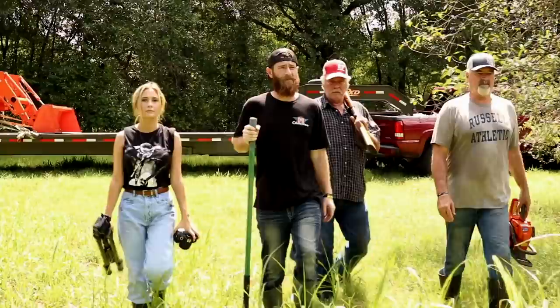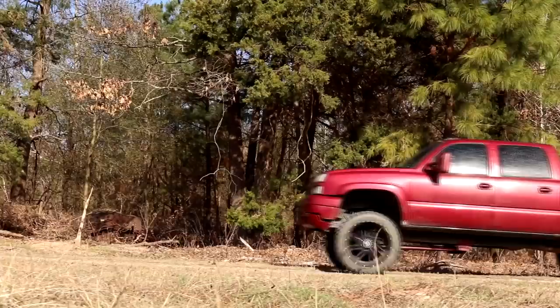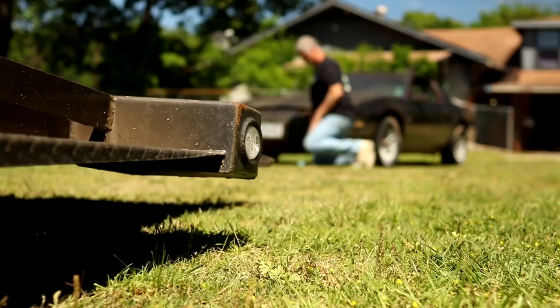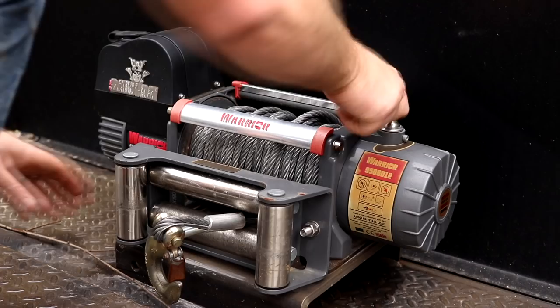Hey, Hank. First off, we just want to say we're really appreciative of you allowing us to be on this channel. We love what you guys are doing over there. We're just a family from a small northeast Texas town, and we have a YouTube channel called Restored. Today we'd like to share some of the things we do to prepare to go out to get these vehicles on the trailer or even get them up and running on the spot. First thing: go ahead and make you a list — without a list, you'll never know if you're forgetting something. You need a good trailer with a working winch, but if not, you can always bring a come-along, a chain hoist, just something to pull the vehicle out of where it's been sitting.